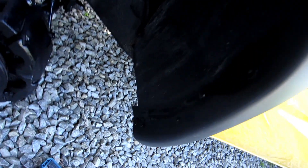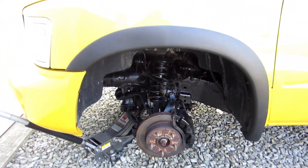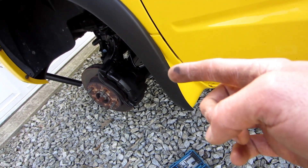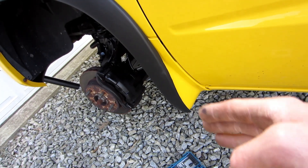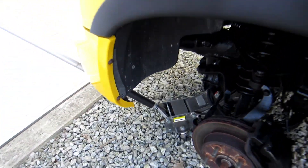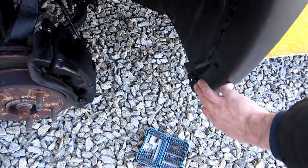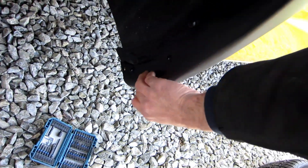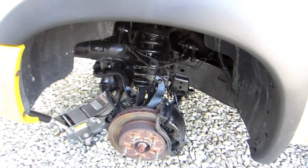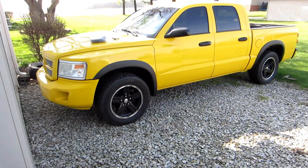I went ahead and painted up the inside — there was a little bit of yellow showing so I painted it so it doesn't stand out. Overall I'm really impressed how this turned out. All I did was take off that little notch like the back fender had, and cut about a four-inch piece off the bottom. I put three hex head self-tappers — the kit actually came with some screws — drilled straight into the plastic, and it held great. I even touched up inside with spray paint to keep the rust down.